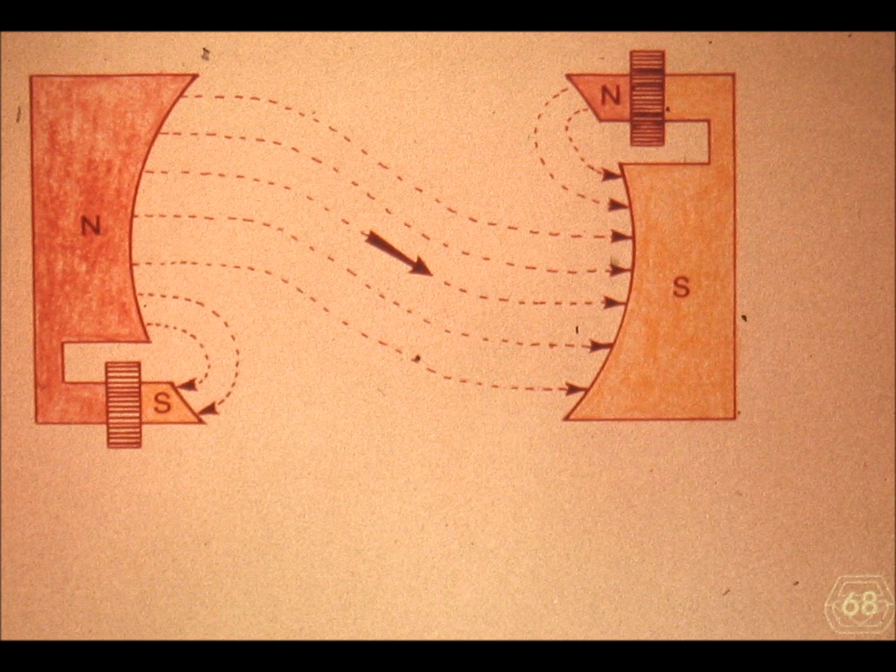The voltage in the shaded poles is induced by the flux in the main part of the poles. Thus the two fields are also out of phase. The distinct axis and the out-of-phase fields interact to produce a distorted overall field that rotates. Thus it is possible to have an AC motor which knows its direction of rotation without the use of a capacitor. These motors become quite hot when in operation, and it is important to use caution when working with them.